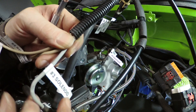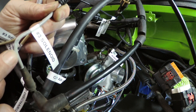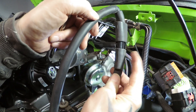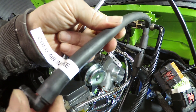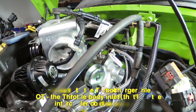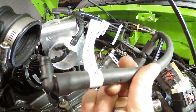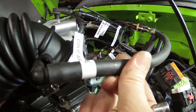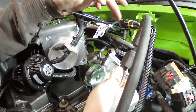For solenoid three, the gray hose goes into almost a loop of connections and splitters. There's a fatter plastic hose going into a splitter, which then comes out in a three-way split. One of those — the big fat rubber hose — goes to the cold air intake. That rubber hose off the circular loop of vacuum hoses connects into the cold air intake fitting.